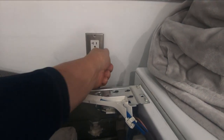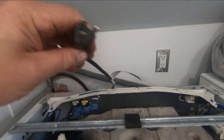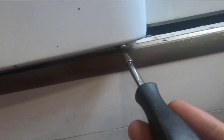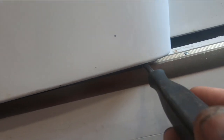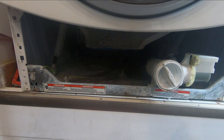Let's get at that motor control board and its connectors. Most importantly, make sure the plug is out before you go to the next step. I'm going to take off this lower cover — there are quarter-inch heads on these screws, two screws one on either side — and then this little cover just pulls out like that.